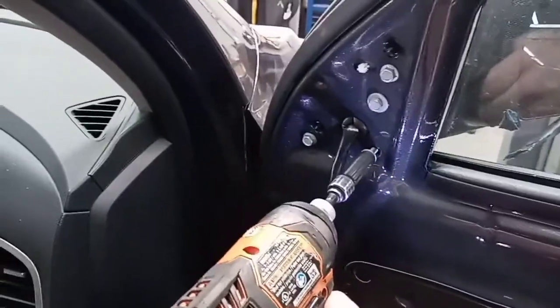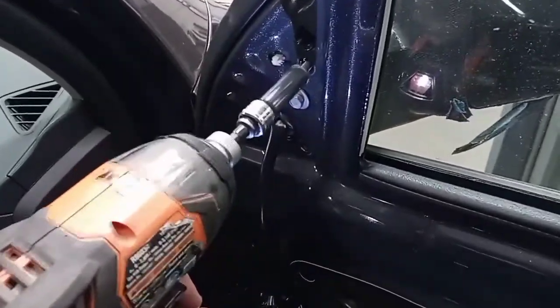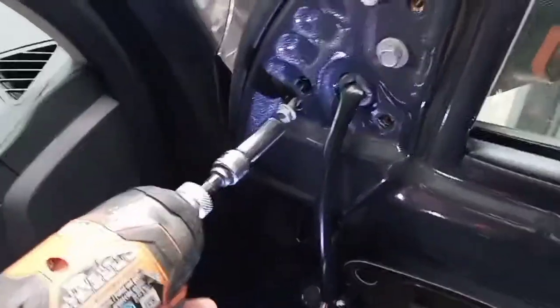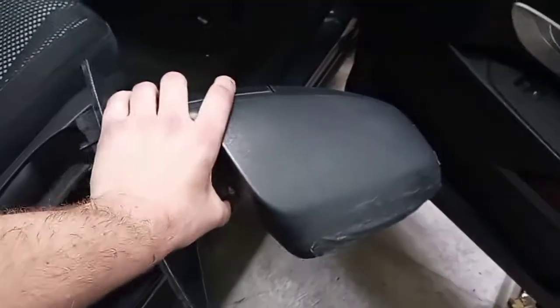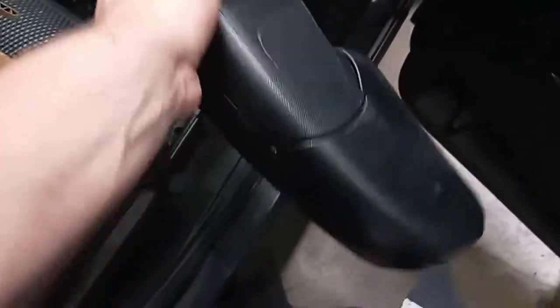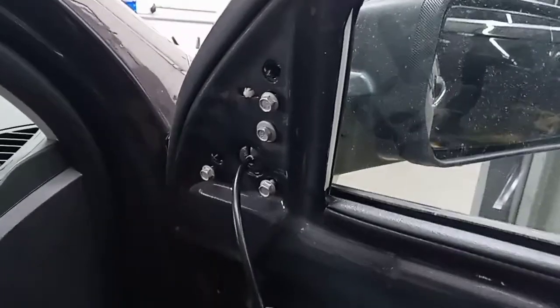This mirror shouldn't really fall after you get these bolts out because there's a little plastic clip. After you get these out, you kind of have to get the electrical connector out and then push this out. There's a little foam gasket type of thing - the new one should come with it. If you go aftermarket, that may be missing, but this is an OEM one.